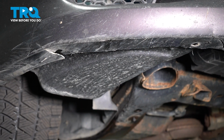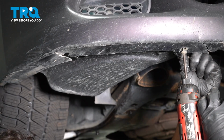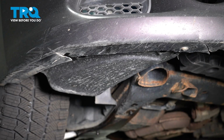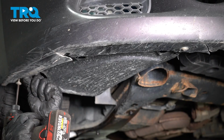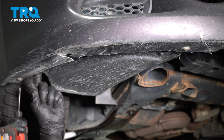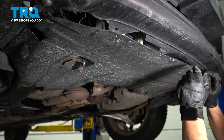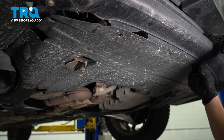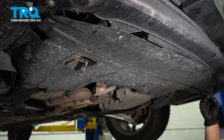There are 4 screws with a Phillips head on them, and they put this corner splash guard snug up to the bumper bottom. Do the same to the other side. Make sure the shield is under the bumper. You don't want the bumper on the outside. Put our first body clip in. Put your hand up on the top. And then go around and do all the body clips.